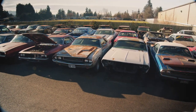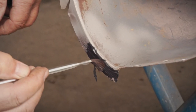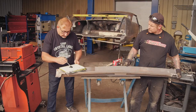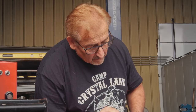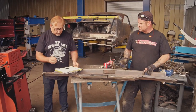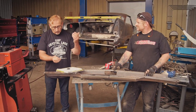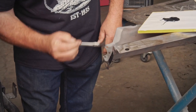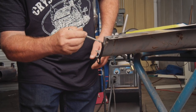The panel bond adhesive is great when you have an area that we can't get in and spot weld or plug weld. Because there's going to be an inconsistency in the heights of the metal, I put it on a little bit thick — if it squeezes out, that's fine. I want to make sure it fills the highs and lows. It's used a lot in the OEM world — manufacturers use it and it's used a lot in the collision world. I was using it back in the collision days, back in the late '90s. They use this very same product to glue quarter panels on cars in the factory and bedsides. When you see crash tests with this stuff, the car will just be wadded up and that panel will not break loose. You have to have clean metal, good grooves, and a little bit of etching — so that 80 grit grinding will take care of the scuffing.